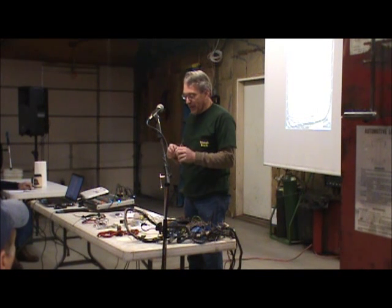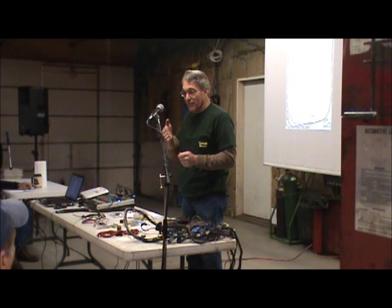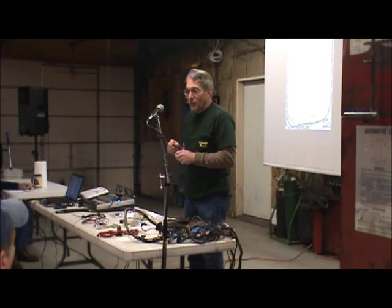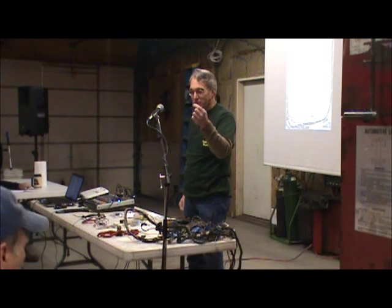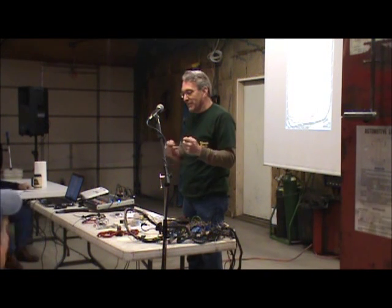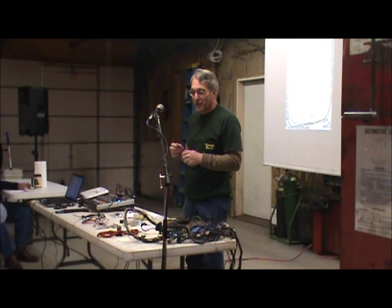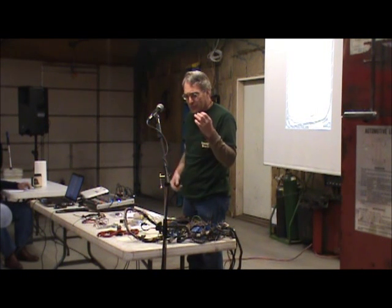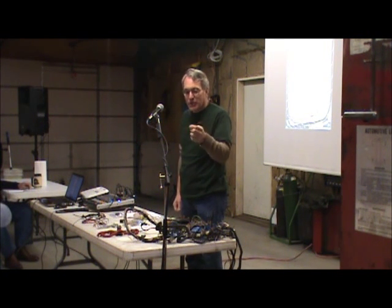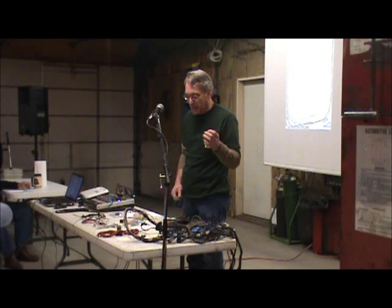Now the customer was ready to, he bit the bullet and bought a complete wire harness from the dashboard forward. We saved him a small fortune because that basically was all that was wrong with his electrical system. And we repaired that wire and taped it back up, with the exception that the tape looked new compared to the other stuff. He was very happy, and it worked just fine. But you can make repairs, but you got to watch out for stuff like this, because you need to get back to a point where the sheathing is still intact.